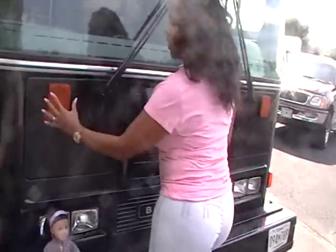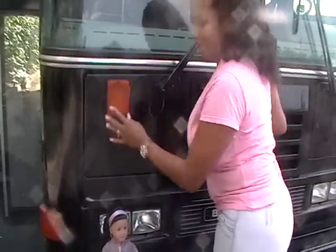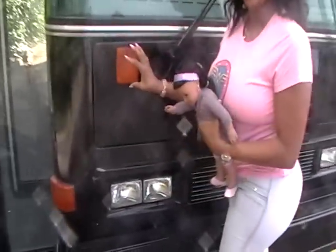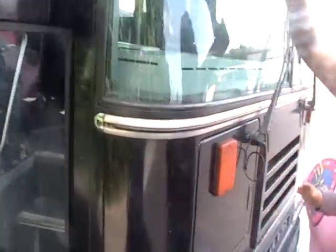And then I'll be checking my amber lenses — making sure that the amber lenses are not cracked, tight and secure. Checking the tension, making sure that the glass is not cracked. I'll be checking my hinges over here, checking and making sure that the doors are functioning correctly.